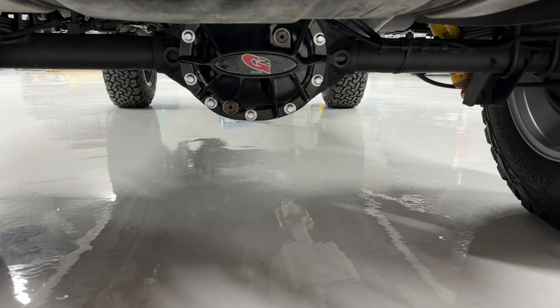A couple little tiny chips right there. Once again the Kevlar finish bumper cap — we removed the back bumper and painted that as well, so it is literally 100% perfect. What you're seeing is just glare from the lights. Besides refinishing it, bringing it down to metal, priming multiple times, sanding, base coat, multiple coats of clear — any imperfections, scratches, or gouges from over the years were all filled in for a perfectly smooth finished bumper.